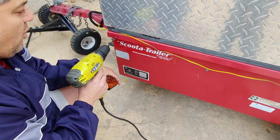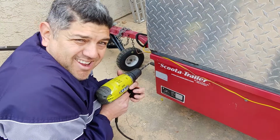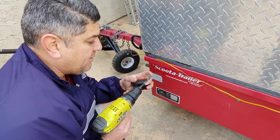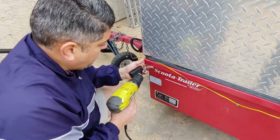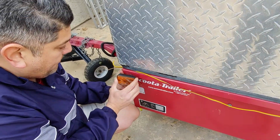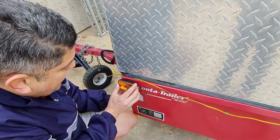When you're going to drill, you don't want to go really fast, full speed. This is metal. You've got to give it time, because otherwise you're going to heat it, and the bit is just going to go dull. I put my finger sideways like this, and said, okay, that's about a finger. That's where I want it.